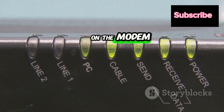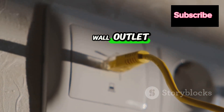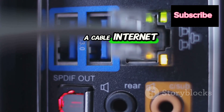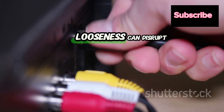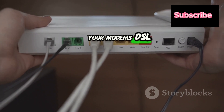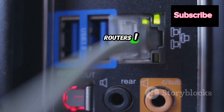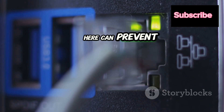Let's focus on the modem first — it's the heart of your internet connection. Make sure the power cable is firmly seated in both the modem and the wall outlet, with no wiggle room. A loose power connection can cause intermittent issues. Next, inspect the coaxial cable connecting your modem to the wall jack if you have a cable internet connection. Make sure it's screwed in tight on both ends. For a DSL connection, verify that the phone line is securely plugged into your modem's DSL port. Then move on to the router and check the Ethernet cable running from the modem to the router's WAN or internet port, ensuring it's snug on both ends.